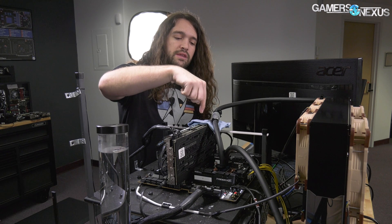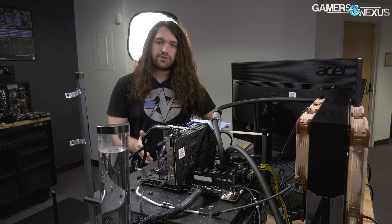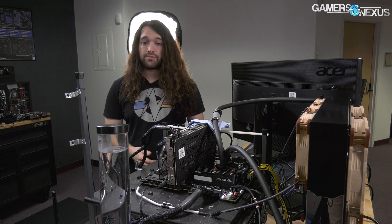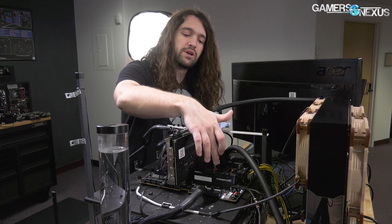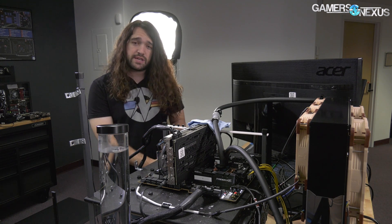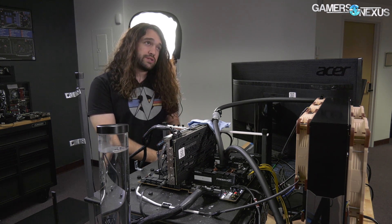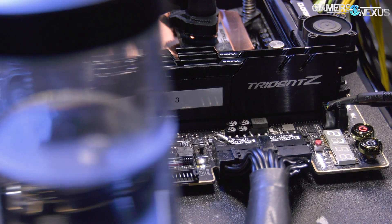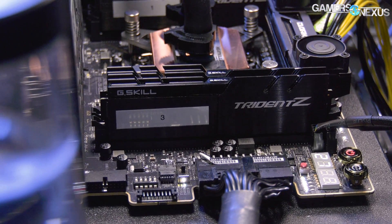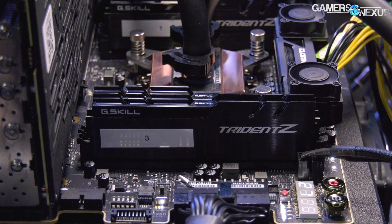The stability issues are partly on the platform/motherboard side. At 4,000MHz, the tertiary timings and some unsurfaced timings get crazy and screwy, and if you can't manually tune them, you basically have to keep retrying boot until it trains. We didn't have patience for that on a stream, so I ended up at 3,800MHz, CL15, with a 260 refresh cycle. Maxed out the refresh interval, pushed tFAW for active window to 38, and most small tertiary timings were at 4 or 6.